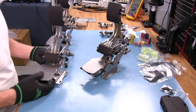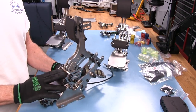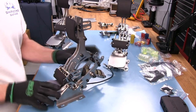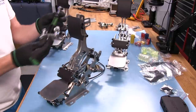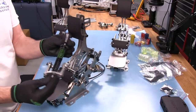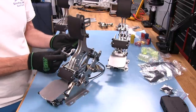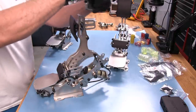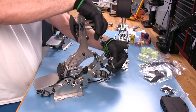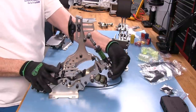It is 120 kilograms. We'll say that much about it as far as maximum force on this pedal, and they have different ways of you achieving that. This brake pedal comes with, in the kit, what they call the advanced brake kit, which includes a preload spring that mounts not in place of the bumpers back here, but in conjunction with. So we would mount this puppy back here, like this, and we put it in like that.